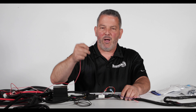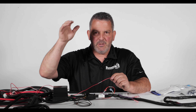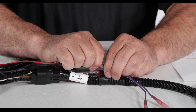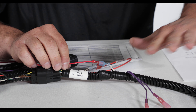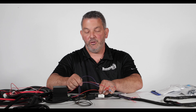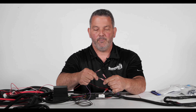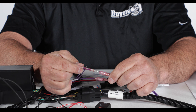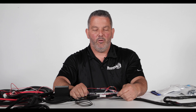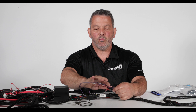Then what we want to do is find our other side of the harness, which is part number 16-0104. This is the harness that goes from the grill to the relay pack. Because we have a smaller end, it feeds up through the grill. So we want to feed it up through the grill and connect it to the light relay pack. Once that's connected, what you want to do is about two inches away on the 16-0104, we want to peel back the loom.